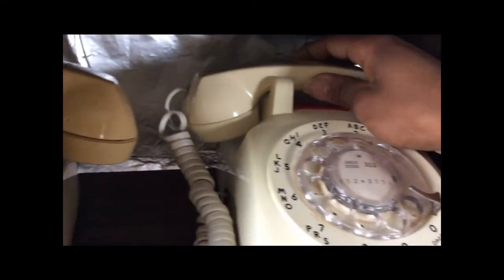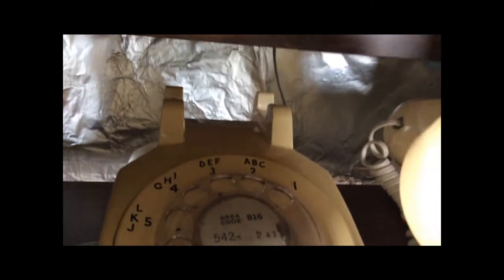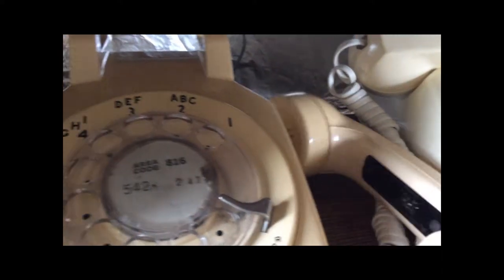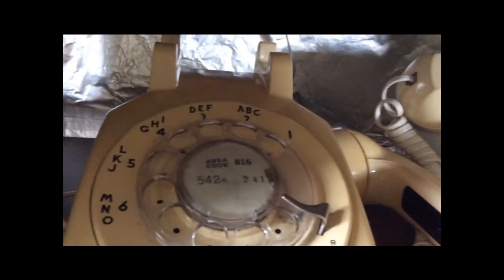Let's demo that here. We'll use this phone to call this phone — we'll just dial 103. So to put this caller on hold, you simply flash the switch hook. Notice you heard those two beeps. Now this handset is resting here — you could cradle it like this phone is cradled, just not hang up. When you're ready to cancel the hold, simply flash the switch hook again, and the call has been reconnected.